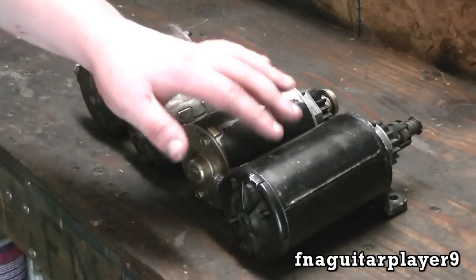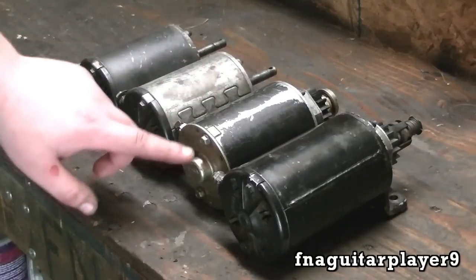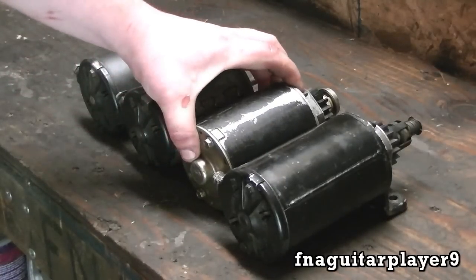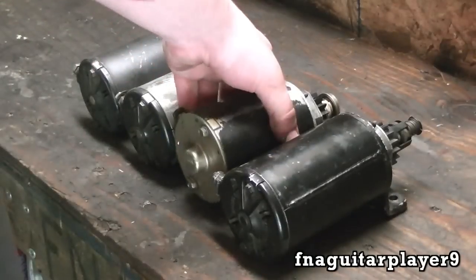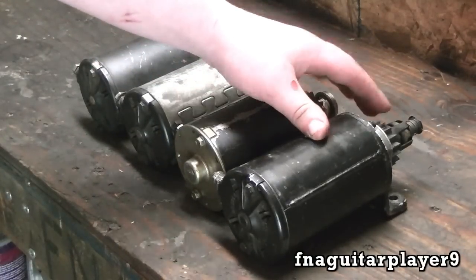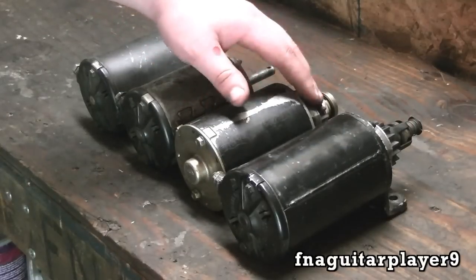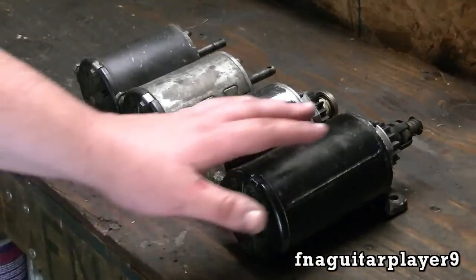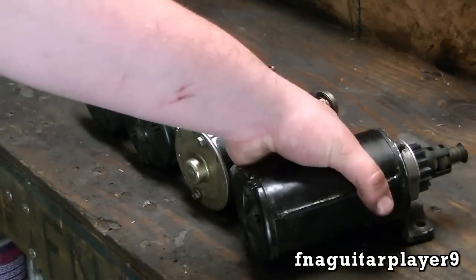There are various types of starter motor. This is one I took off — you'll notice it has a slightly longer housing; it's off a newer engine. These are interchangeable. The newer ones usually come with a metal gear, so you've got to make sure you have the right type. If your flywheel has an aluminum or plastic gear, you need a plastic gear on the starter. If it has a steel ring gear, you can run a steel gear on the starter.